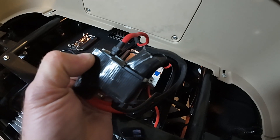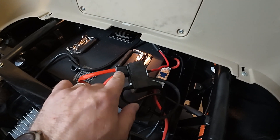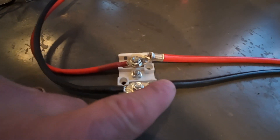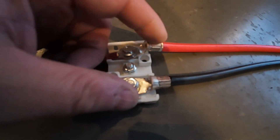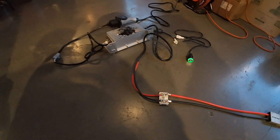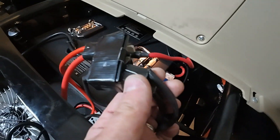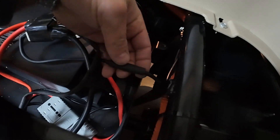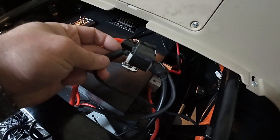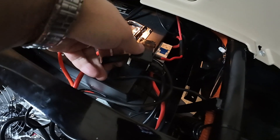The junction box will not close easily, so I'll tape it over as much as possible with electrical tape or duct tape. Remember, bare metal wires cannot be exposed and cannot touch any metal objects. If you don't have shrink tubing, tape them over with electrical tape so they're not visible — that's why you see this electrical tape here and here. But if you have shrink tube, you can slide it to the end of the connector, heat it up, and isolate the end.